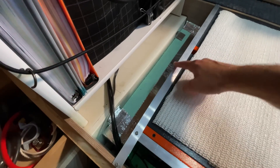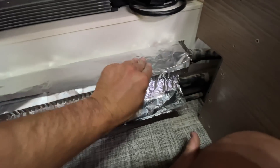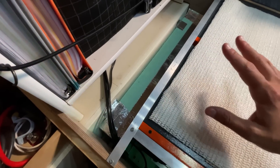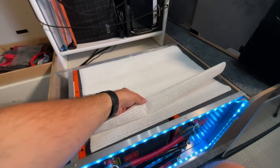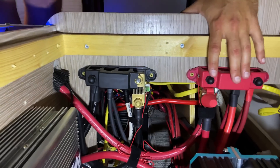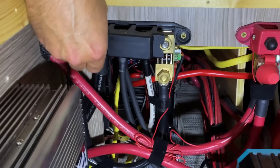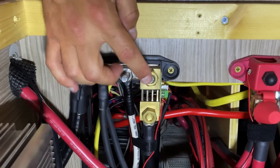In the back of this battery system, one of our Aldi radiators is back here and I didn't want all that heat inside, so I built foam insulation around it. I also wrapped the heater fins with about six layers of aluminum foil to stop the convection and built a piece of insulation over it. It's just getting cold enough to test this out and it's actually kept things nice and cool — I don't want it heating the back of the batteries. There's also shelf matting on here to help hold this floor panel in place and protect the batteries from scratching since we walk on this fairly frequently. I've got my bus bar power distribution blocks down here and had to make some modifications.